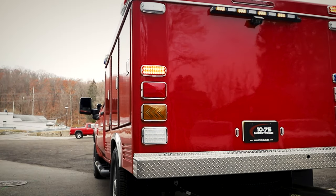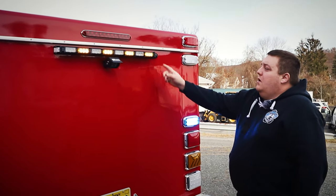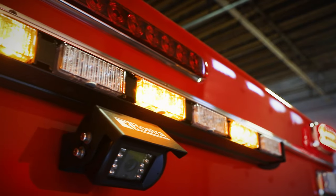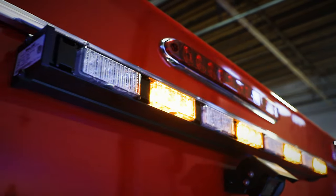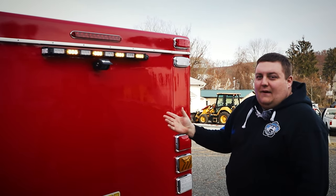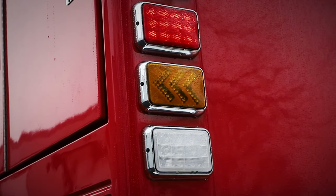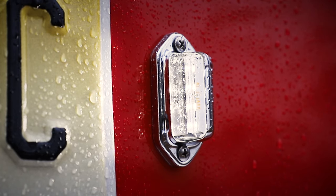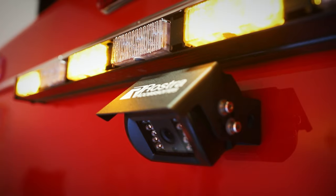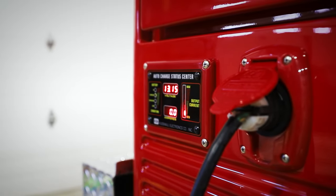Back of the truck: Tecniq third brake light, Whelen M7 warning lights, and a Whelen TR3 arrow stick that we've rewired into Blueprint, so we're able to control the flash patterns and the sync, and we still have arrow stick functions. We have our C6 Whelen stop/tail/turn lights, and then we have our Tecniq marker lights, and we've reintegrated the backup camera into the electrical system, so they still have the backup camera on the factory screen.